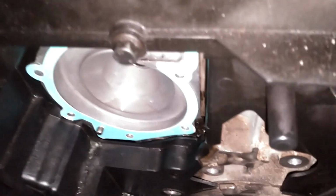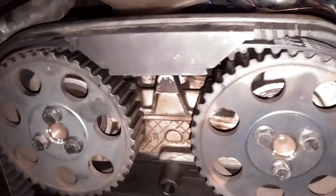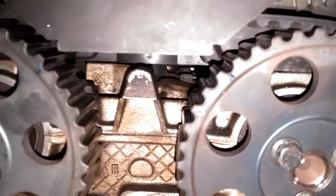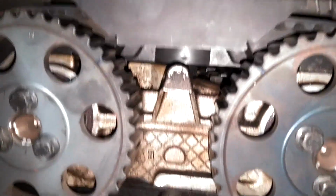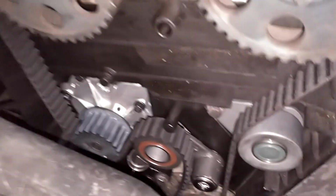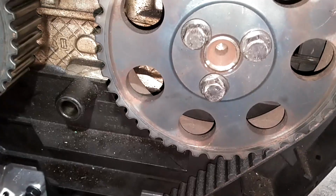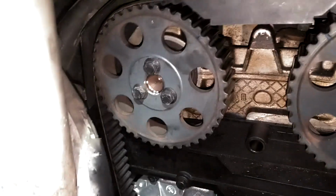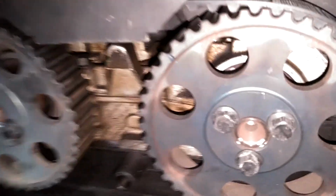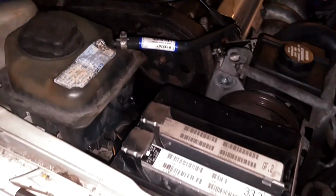Now I'm going to set the pump in place, press them on the holding pins, and put the bolts in it. Timing looks good. Marks are set. We're going to pull the pin, roll her over, double check timing. I got these cam sprockets tight. Marks stayed with me. Cam seals pressed in. Then we're going to do the oil cooler lines if we got time.